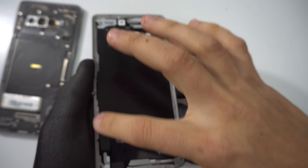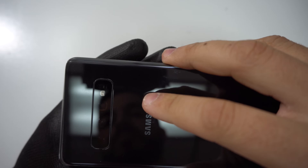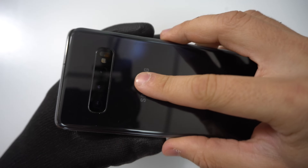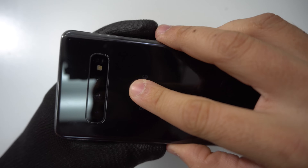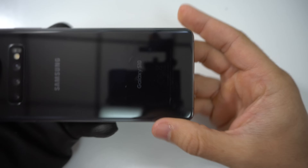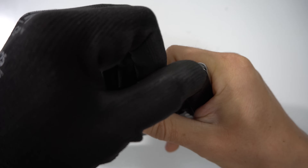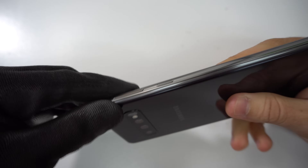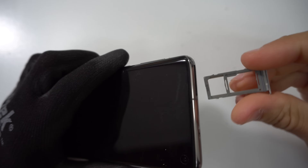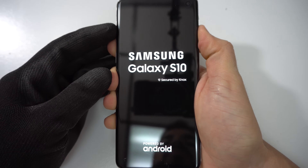Make sure that the adhesive on your back cover is aligned correctly so that we can glue it back to the frame of the phone. Go ahead and position the back cover to the back of the phone — position the top corner first, and once that's aligned correctly, place the rest of it down to the frame. Make sure everything is aligned properly, then squeeze on all sides of the back glass, going around all of the edges and giving it pressure, squeezing them firmly together so the adhesive can do its job. Go ahead and place your SIM card tray back in, and then you're ready to power your phone back on to test it out.